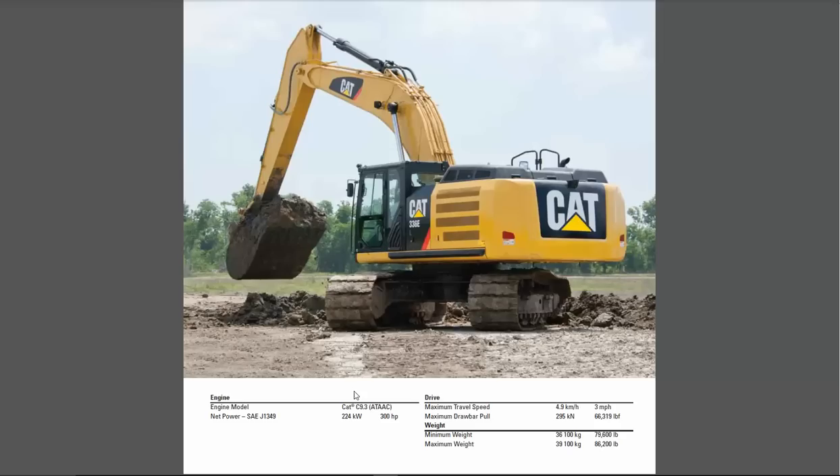In our course we go through how to move heavy haul freight. This isn't really heavy haul — 80, 85, 86 thousand pounds is baby stuff — but for a good conversation we're going to call it heavy haul, kind of beginning heavy haul. We've got our weight down; we know we're going to need an RGN. As a general rule, at the max weight of 86,000 pounds, I'm going to be searching for an eight-axle RGN. That's a combination of axles on the truck and axles on the trailer — eight total axles so the weight can be distributed correctly.